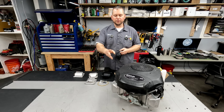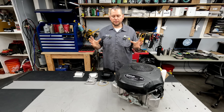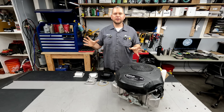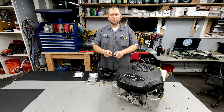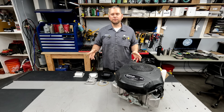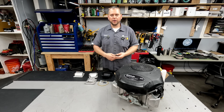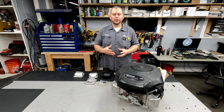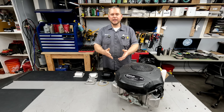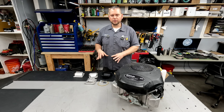Whenever you adjust the valves or do some valve work, you don't have to mess with that whole Permatex thing. It's a mess, it takes a lot of time, and everybody's frustrated with it if you've ever done it. If you're frustrated with pulling the valve cover and getting the valve train serviced, you're a lot less likely to do it. You've got to adjust the valves periodically on this engine, and you don't want to deal with Permatex every single time — or wait for it to dry before you get back into action. The upgrade saves you a lot of time and frustration.